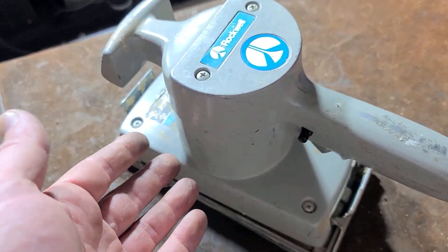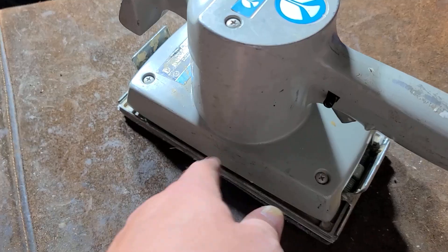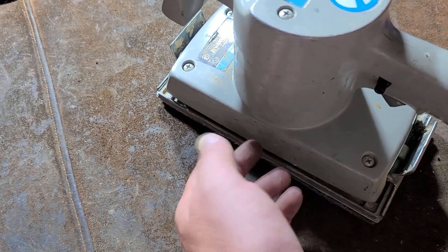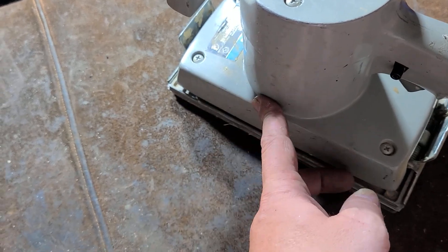The rest of the video I just described taking it apart and just a couple of the caveats, like how the motor sander likes to get kind of stuck in this mid bearing. So sometimes you have to press it out or use a puller to push it out to get at that middle bearing.